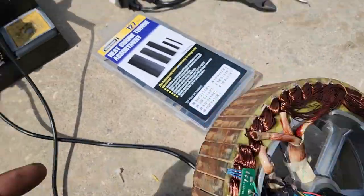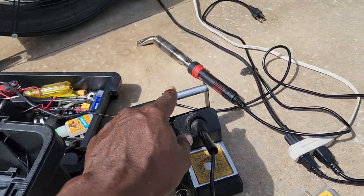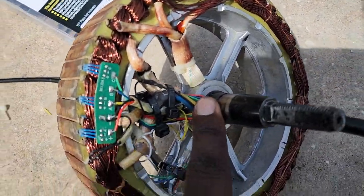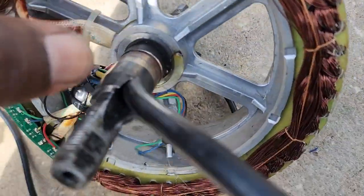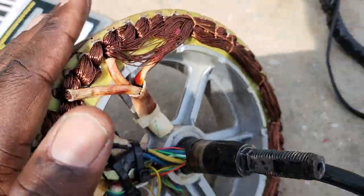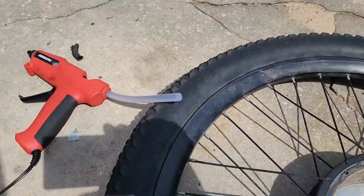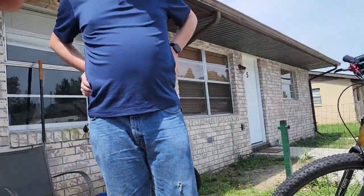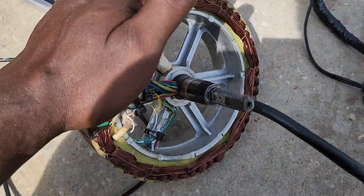The phase wires were a challenge — I had to use the Mammoth tool I got from Amazon because the Chinese manufacturers must have dipped those wires in something; I couldn't get them loose with the regular tool and had to use the Mammoth. Now we're going to hot glue this right here to keep the wire from chafing against the axle, and hot glue over here too. Once that's done, we'll go ahead and put it back in the hub and get it on the bike and hopefully do a test.